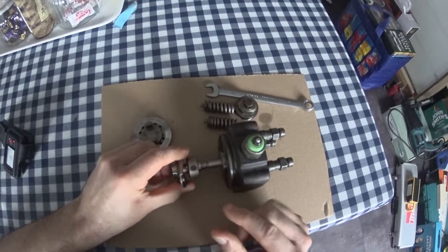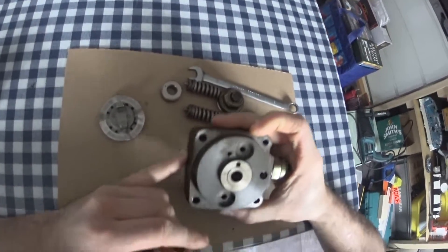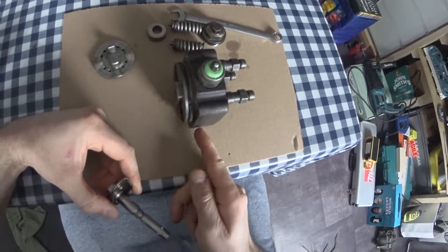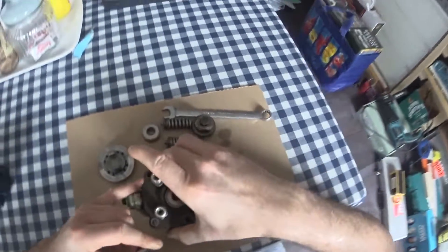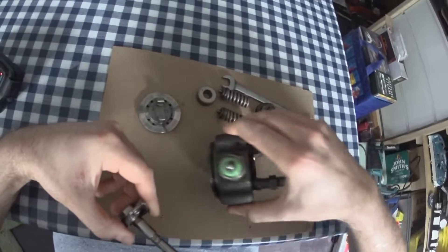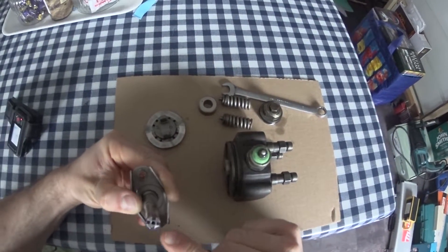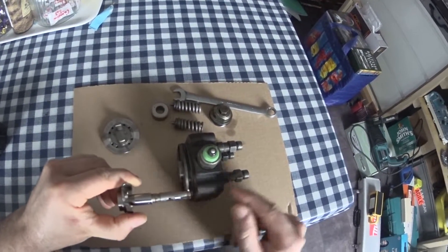So I'll just go over that start bit again, because there's a lot going on. Four holes, 90 degrees from each other, in line with these, about here. A drain port here, and a fill port right at the back. Remember it's filling in here from the top, flowing up there — which is hollow — and then out of here, going to each cylinder.